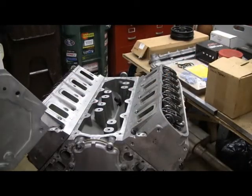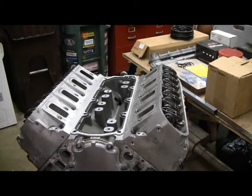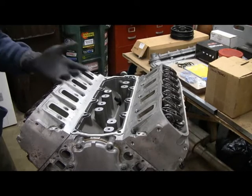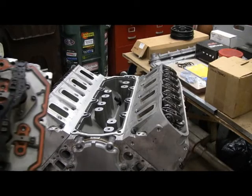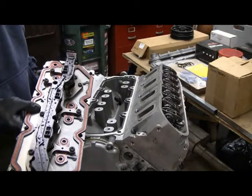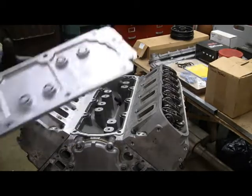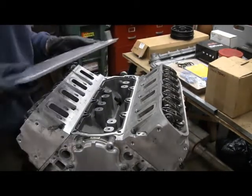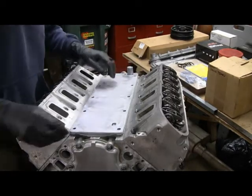Installation is pretty simple. Basically put your gasket down and then put your cover down over the top of that. All these holes or ports you see — that's where the oil comes up when you use the DoD cover. We don't need those, so on the bottom of this one there are all these o-rings to close those off. It only goes one way, and torque the bolts down to 18 foot-pounds.